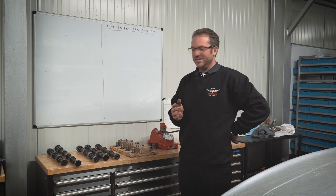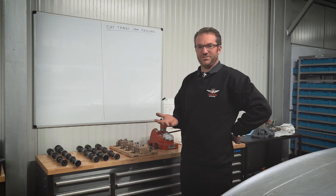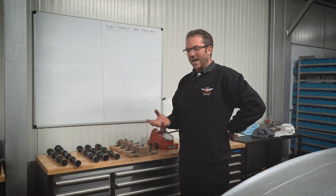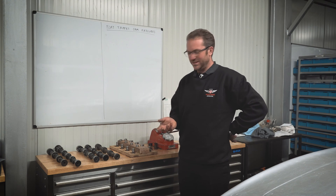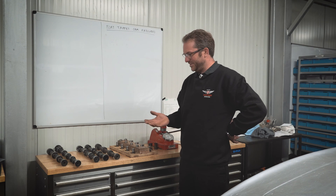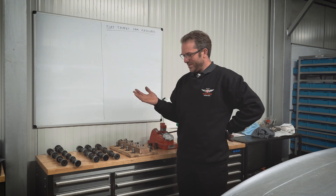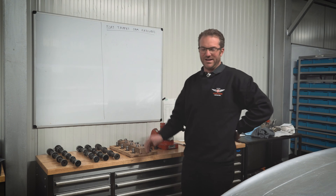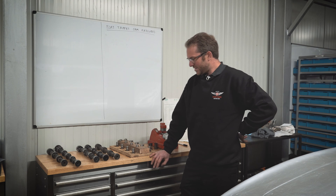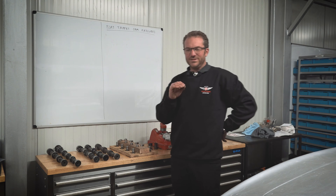You keep doing that for about half an hour. Why run it at 3,000 RPM? You'd think you'd want to run it lower, but that's to make sure you've got a huge amount of oil supply. If the engine is idling, oil pressure could be low and you're not getting sufficient oil delivery to the camshaft. But at 3,000 RPM you're definitely going to have plenty of oil pressure and plenty of oil flying around up the top end.